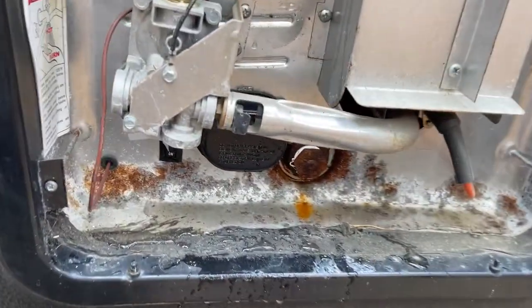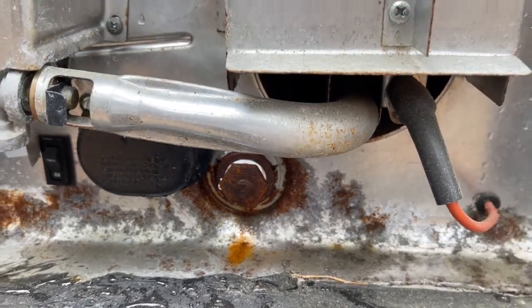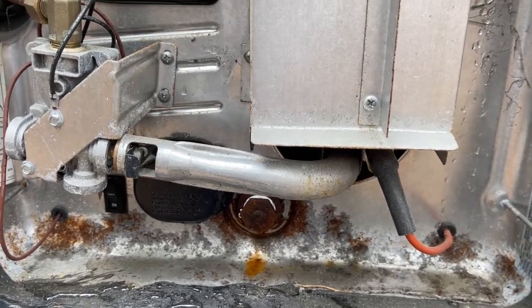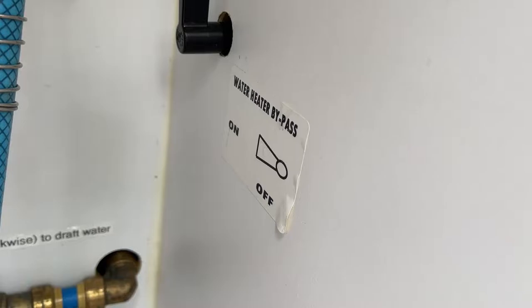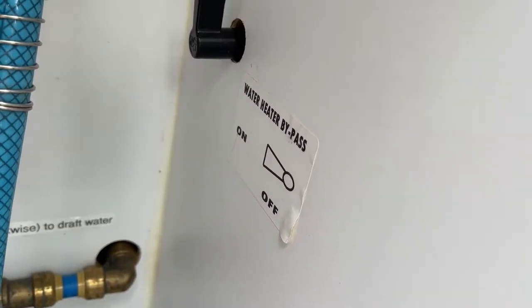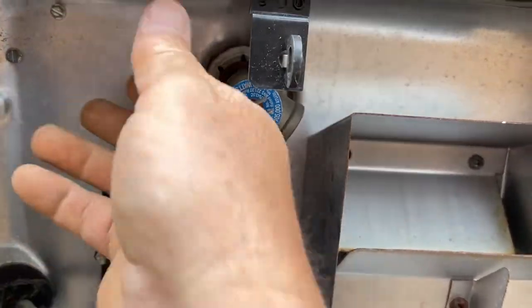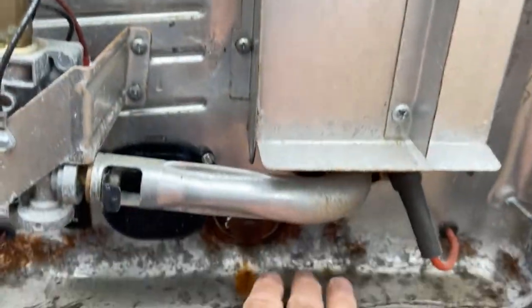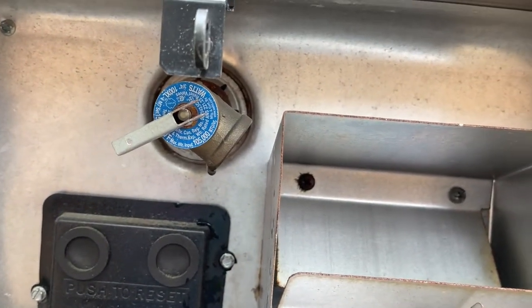I haven't pulled it yet but I'm anticipating it's not going to be pretty. I've gotten lax and I do have a little surface rust here — nothing really to worry about, but I'm going to clean all this up. For the first step, release the pressure in the tank. The hot water has been turned off all day so it's not hot inside. I've turned my water bypass on — if you do this, there's no need to turn the water to the rig off, so someone inside can still use water and you'll have no issue with pressure in the tank. Once that's off, come over here and flip this pressure relief valve up. That's where all this water came from — you'll get a little burst of water, but once that's done the tank is depressurized.